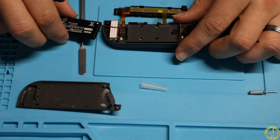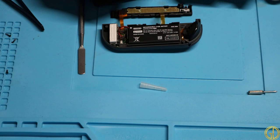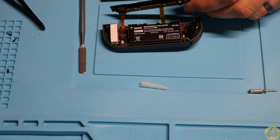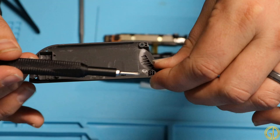Alright, we'll go ahead and put the battery back in where it goes. Now, a couple of things happened with this. Right here, the little release button actually came loose whenever this thing came apart, so we'll just slap that back down in there. And right here, unfortunately there was one piece of broken plastic — it's kind of hard to see in the video, but it's actually a screw on the other side that connects to this spot. So what I'm going to do to help put that back into place is throw a little dab of industrial strength superglue on there.